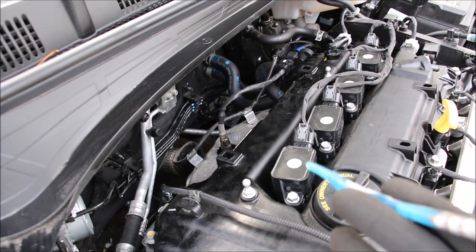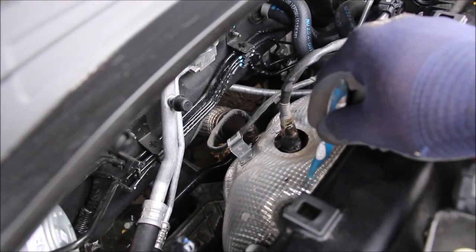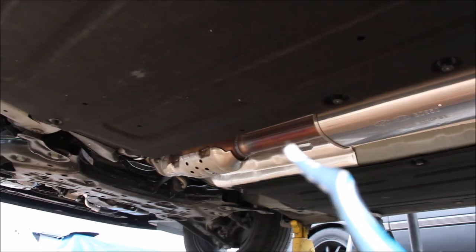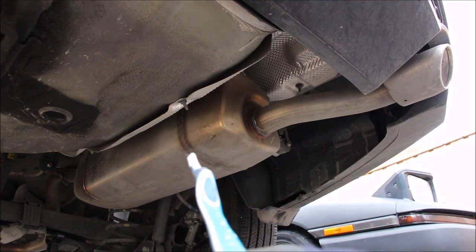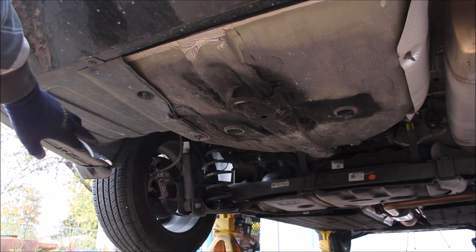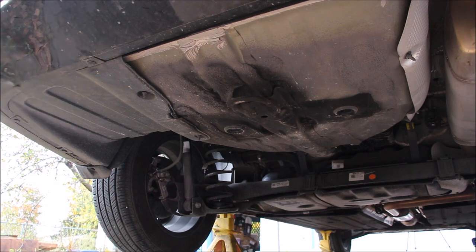The exhaust manifold in this car is fairly straightforward. Being a four-cylinder, we have a single steel manifold with an integrated catalytic converter, an oxygen sensor, and it goes into that flex pipe down below. The exhaust then goes through the secondary catalytic converter, a central muffler, and then out the tailpipe. It'll then come through this square-shaped muffler at the back and out the tailpipe. This one does not have dual exhaust — just an empty plastic panel where you would put the left muffler.